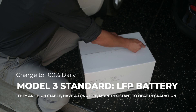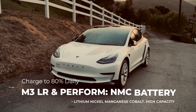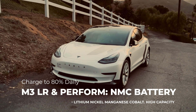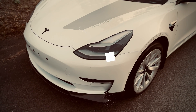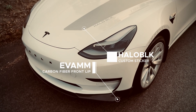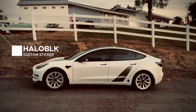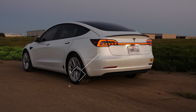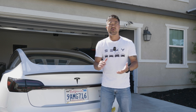One thing about charging your Tesla Model 3 Standard — the newer battery likes to be charged to 100 percent all the time. But if you have a Long Range or Performance, it likes to be charged at 50 to 90 percent. I keep my charge at 80 percent most of the time and charge to 100 every once in a while when I know I've got a long drive. Elon Musk even said don't go to 100, just go to 90 or 95, and let the regenerative braking work — because at 100 percent, regenerative braking doesn't work since the battery is already full.